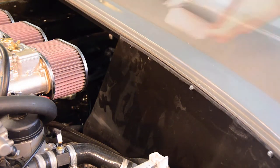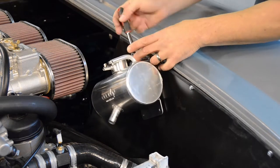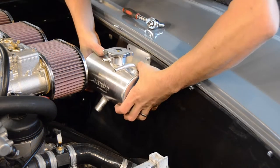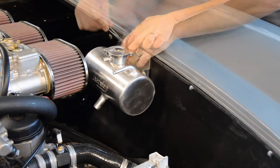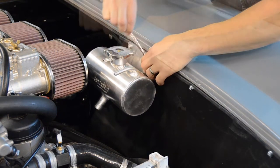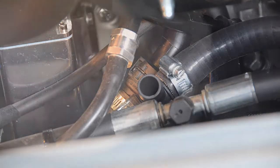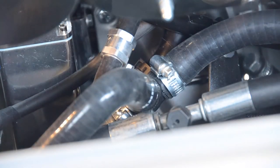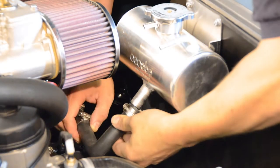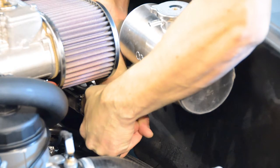With all of our mounting panels and body support ceiling panels now successfully installed on our chassis, it's now time to fit the water expansion tank, which will be secured to the chassis using the two remaining top bolts of our left-hand engine bay panel. With the water tank now securely in place, we can now go ahead and connect it up to the engine. Both ends of our main water pipe can be secured in place using the pre-fitted Jubilee clips provided.